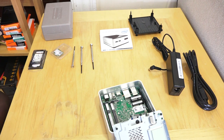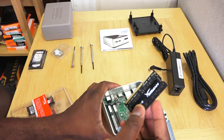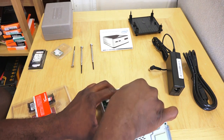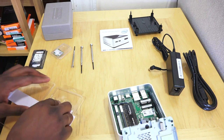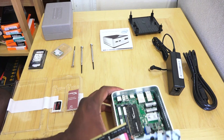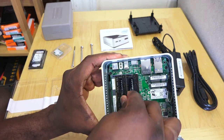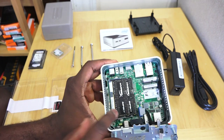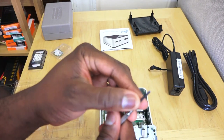I'm going to install the memory first. I'll slide the bottom stick in and lock it, then slide the second one in and lock it. The first time I did an Intel NUC video I didn't seat the memory properly and everyone pointed that out, so this time I made sure. That's the HyperX memory — I apologize, not HyperX Fury, just HyperX.